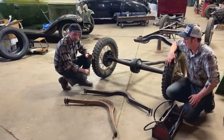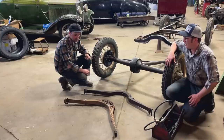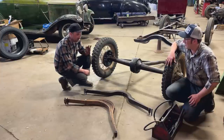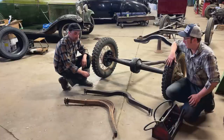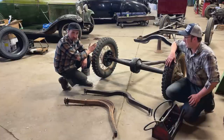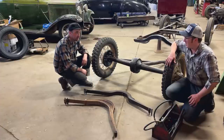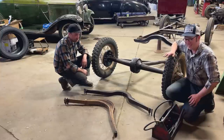You can use plastic modern bushings, but I prefer to always use the original type because they just seem to last longer, fit better, and look better. You drive them out, put them in, ream them to fit, and they're just a perfect fit. The rear end's been cleaned up; we haven't done the brakes yet. We figured we should put the spring on the rear end, put the rear end in the frame, and then put the body back on the frame for the first time in months — get the horse back on the cart, so to speak. Let's get to it.